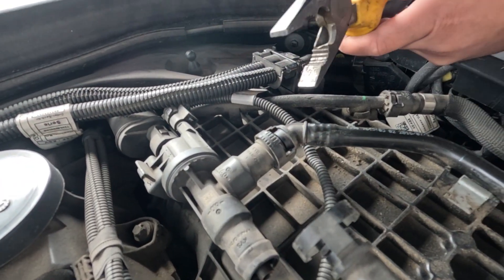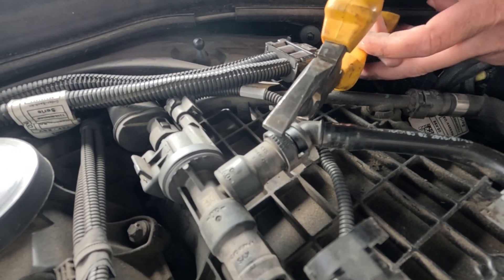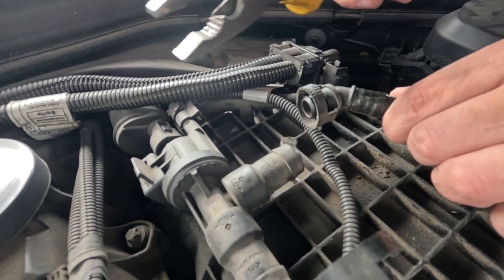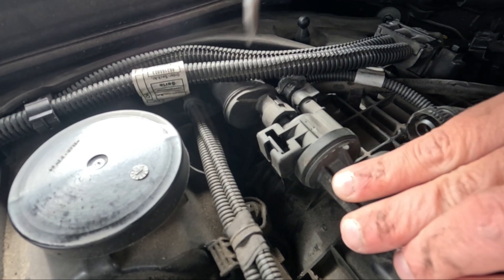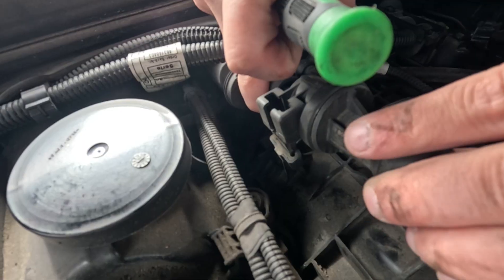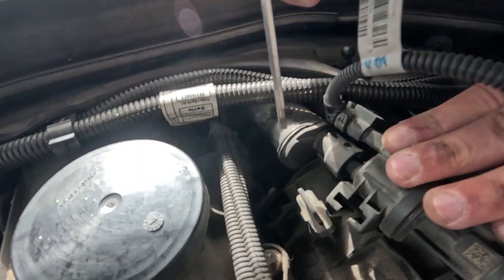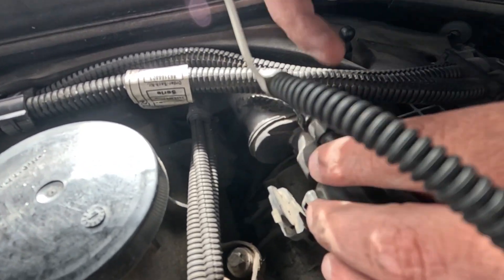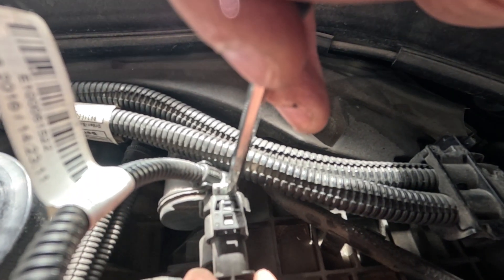The second clip is the same thing — on the groove side, put the plier there and pull it out. Note that the piece won't slide out to the front, so you have to slide it out of the spot BMW made for it. Just pick it up a bit so you have more space to work with. There's a grey piece in the back that's supposed to sit like this — you just want to push it back.